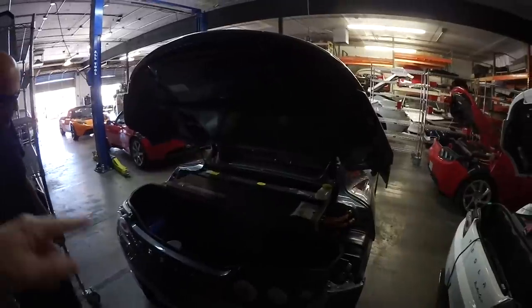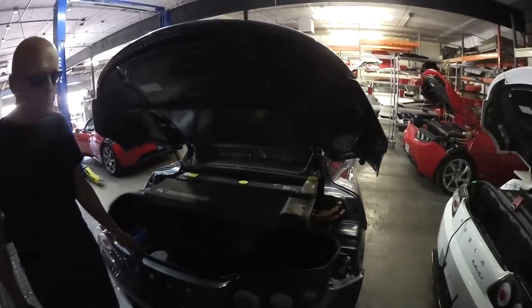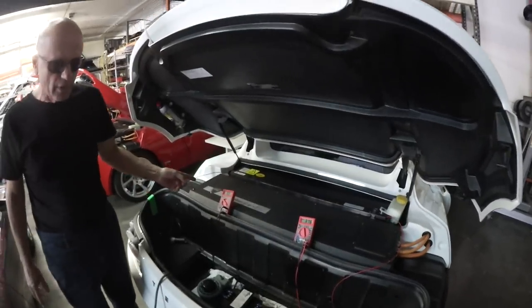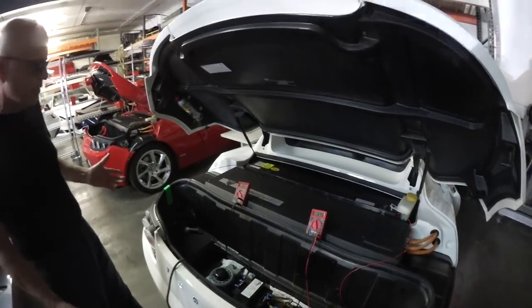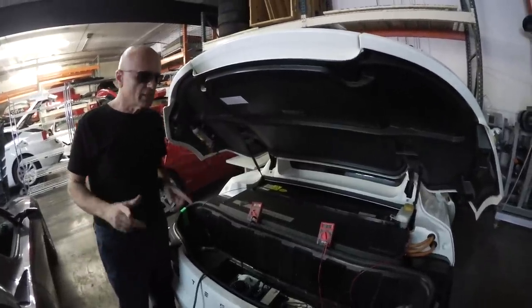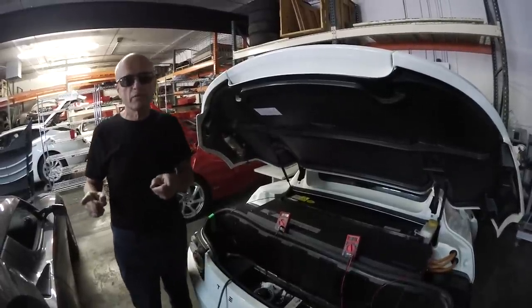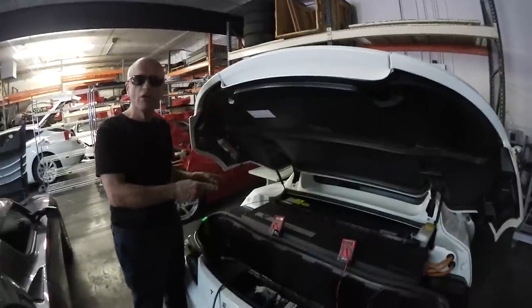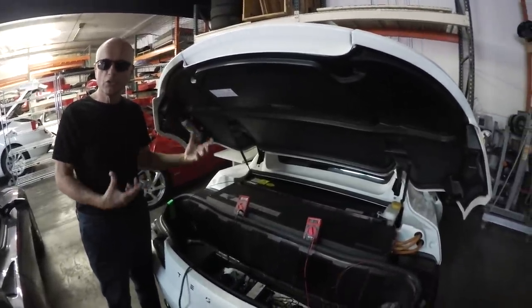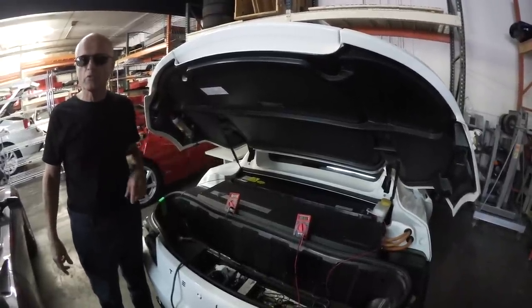Did you already rework this PEM or will you rework it here? This one just came in. It's a car from Florida, the owner is in Puerto Rico — it's a 3.0 battery pack here for recovery. The lesson is: just because you've spent $30,000 to get your Roadster battery pack replaced doesn't mean you're immune from bricking. The design flaws are still inherent in the ESS pack. You still need to charge that battery. This one is coming up nicely and we feel we'll do a 100% recovery.